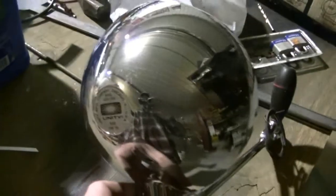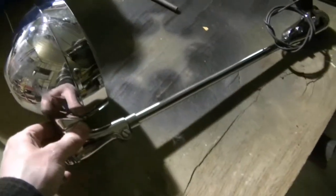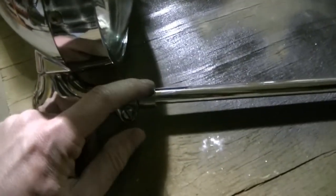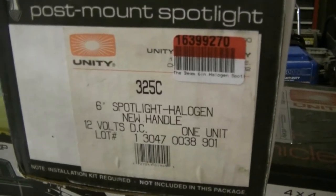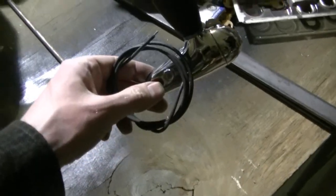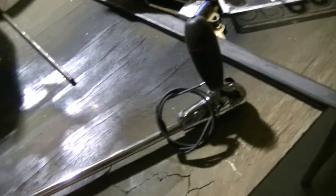Here's the light I'm going with for dad's truck — it's a 6-inch Unity Spotlight, model 325C. This one is chrome, brand new. I picked it up cheap on eBay. It's got the bushing for the mount already on it and the handle. I'm going to pull the handle off to slide it through — there's one bolt right there holding the handle on. Take that off, slide the handle off, and slide the shaft through.